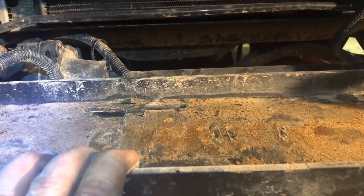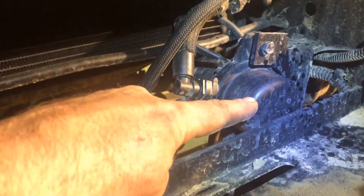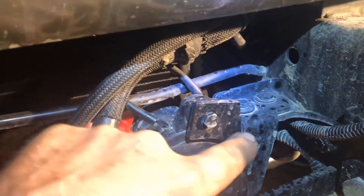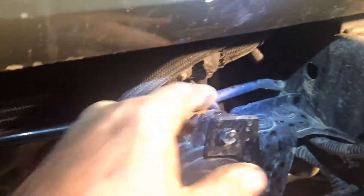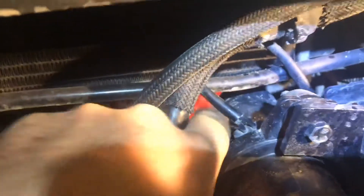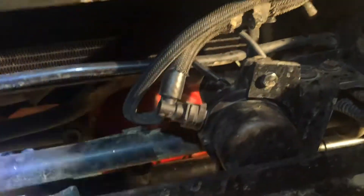The winch plate has to go out of the way because the Evo Quarter Pounder has its own winch plate welded into it. You can see the vacuum booster right here — this unit is normally vertical, and it's right here, so this needed to be relocated. This bracket here — you use the original hardware, disconnect it, and there's a bolt that goes through. It's kind of like a backwards letter C. It hugs this, and you reverse it horizontally and tuck it in just under the radiator. Then two bolts hold it in place and that gets it out of the way.